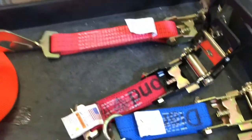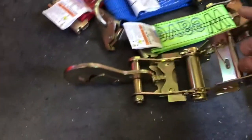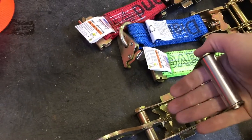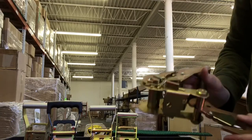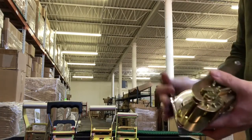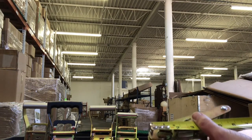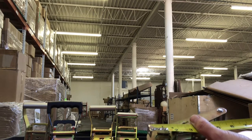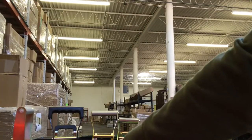One thing we're always fighting is space in there. So we have this — it's actually a ten-thousand-pound mini ratchet. I can get three fingers in there but it's pretty small. With a bolt-on snap hook, you're going to take a lot less space when you get out to your D-ring at the end. This thing takes up a total of nine inches from the ratcheting portion to the end of the hook, whereas the first one I showed you is more like 20 inches.